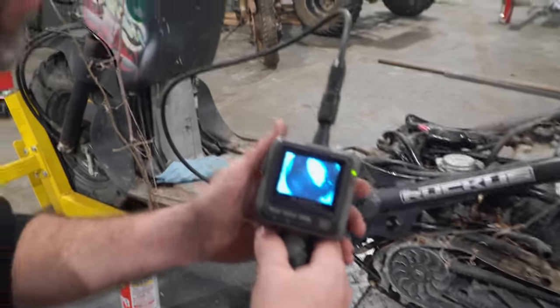We got the feeler gauges. Not the feeler gauges, but the micrometer. It's in John's toolbox. We'll get it and measure the exhaust and the intake and see what they are. I might be able to take the exhaust shim and put it on the intake, and that would then be just shave one. That would be cool. Okay, let's just see how out of spec they are.